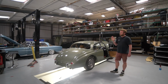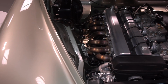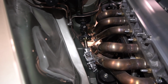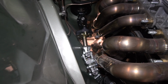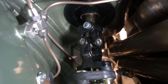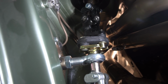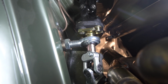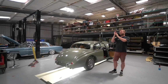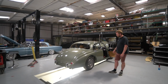Basically because of the way the XJ40 rack, I think it is, we've got in there, has a very steep pinion angle. So it's quite a tight angle to get between that and where the column comes through. So we've got a double universal joint, which we've currently just mocked up by having 2 universal joints back to back with a little joiner shaft. But what we are going to do is machine our own section for the middle, so it basically becomes a double universal joint. And then on the sort of downlink to that joint, because with the double joint, if it's unsupported, the column will just sort of flop around because of the 2 joints. You have to actually support the column shaft itself, so we've got a rose joint, which is just making up, which basically supports that intermediate section of shaft. So that's the sort of finishing touch on getting that steering linkage completed.